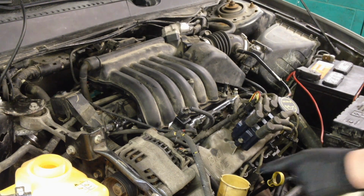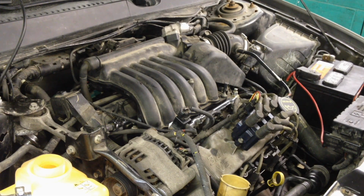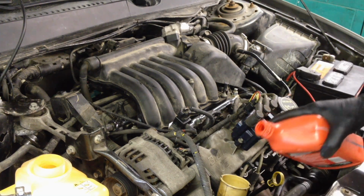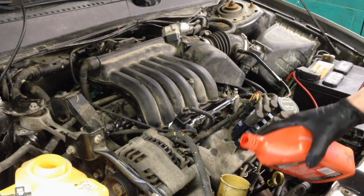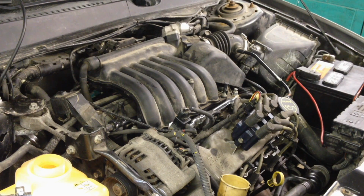This is our power steering pump, it sucked it down and started filling the lines. We can adjust the fluid level so that when we do start, it's not sucking air immediately. So now that's partially bled, and we can top it off.